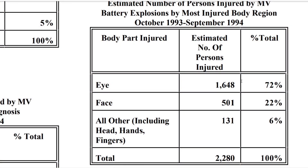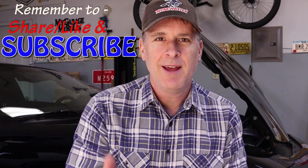Automotive batteries are known to contain hydrogen — the gas that blew up the Hindenburg — and they also contain acid. If you've had high school chemistry, you know that's not a very good combination for safety. Anytime you work with your car's battery, before you even think about touching those cables or putting on a battery charger, at a minimum put on safety glasses — better yet, a face shield, a long sleeve shirt, and goggles underneath. Explosions are rare, but every year in the United States there are at least 2,200 cases of serious injury requiring hospital care, the majority involving acid injuries to the eye. I'll leave a link in the description to the NHTSA report. Now get out there and replace your C5's battery — thanks for watching.